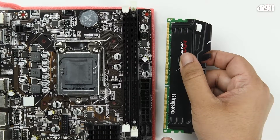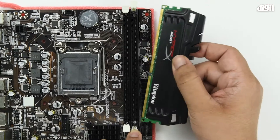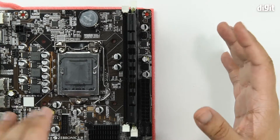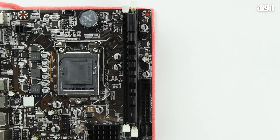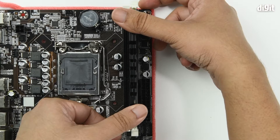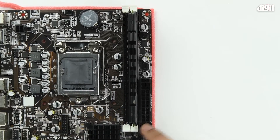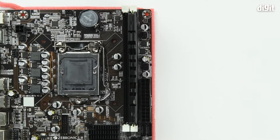Once that's done, slip the corners into the little sliver in the center and your RAM module will just fall into place. Next, press it down and secure it — take your thumbs, place them at both ends, and slowly apply pressure downwards. You will see that the hooks at either end automatically engage and your RAM module is secured.